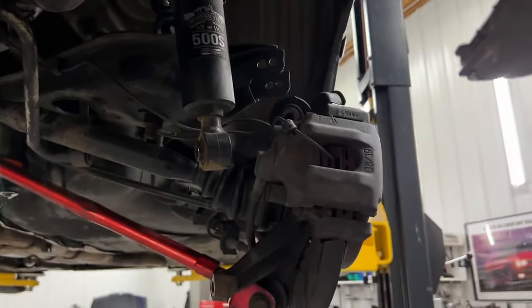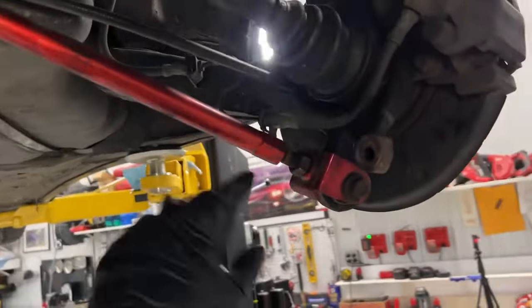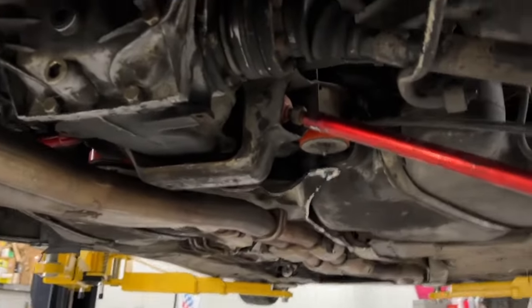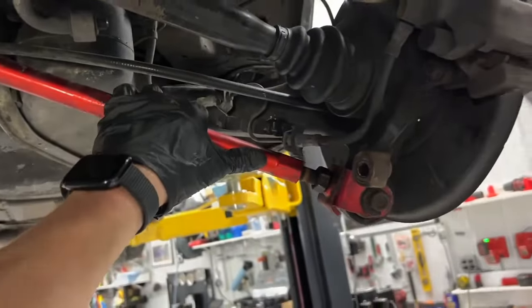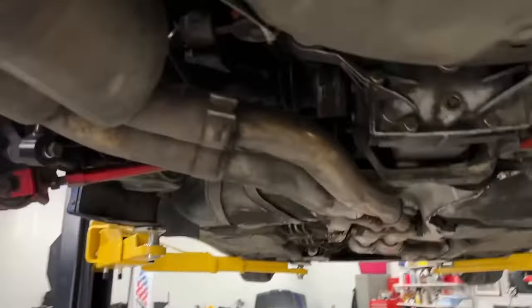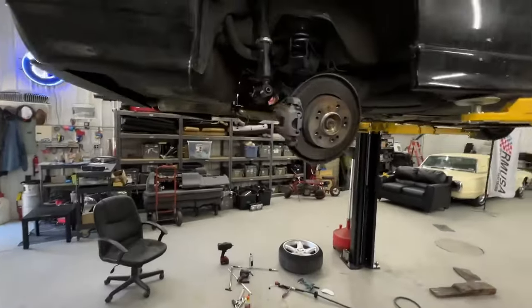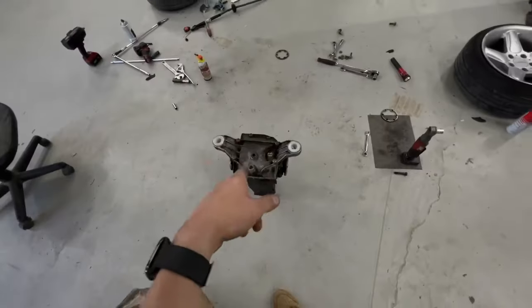What that's going to do is bring the knuckle in so you'll be able to run better wheels. Next, we're going to bring the lower control arms in, and then we're swapping diffs too. We may also need to pull the axle spacer, but we're going to see if we can get it to fit without pulling it. Got some paint drying and we'll get it back together and see how it looks.